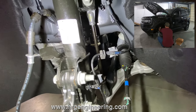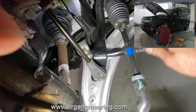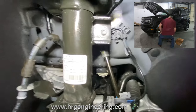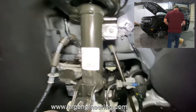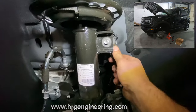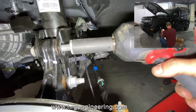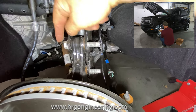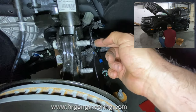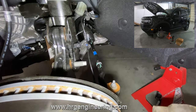Now that we've got the ABS and brake lines off, the next step is removing the sway bar link, which is going to get replaced with a shorter one. To get it out you actually have to steer the car a little bit to the right - we're doing the left side now. Important: you want to take the nuts off, do not turn this side because it's splined and it'll mess up those splines. We're going to tap it right here to get the bolt out.